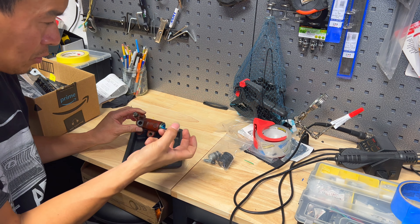Let's fill this thing with some super clean, let it soak a little bit, then clean it out with a rag. We might have to get a rubber brush or a little wire wheel inside there — just don't damage the walls too much. After cleaning this piston, you can see the seal on the top is deteriorated right on the edge where it meets the metal. This definitely needs to be replaced as part of the rebuild kit.